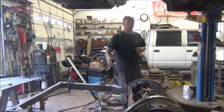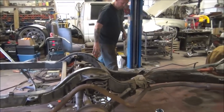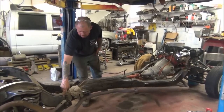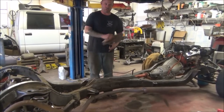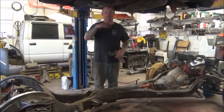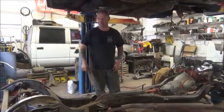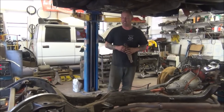We took those precautions and we're boxing starting from the back, forward, up over the arches. We haven't got there yet, but we're going to move alongside the driveshaft tunnel all the way to the front arches. Currently we're just behind the lower control arm mounts, but still moving forward. Bear in mind, we just started this yesterday — I pulled this car in yesterday, and in about two and a half to three hours we had the body separated from the frame, worked till two in the morning, showed back up at 8:45 this morning. So this is only about a day's work. Granted, there are several people working on this, so if you're trying to do it yourself it's going to take significantly longer.